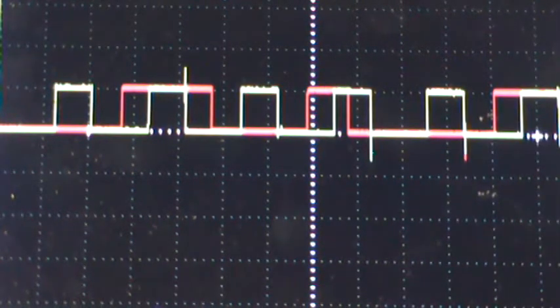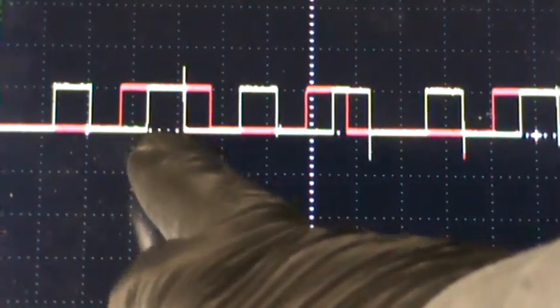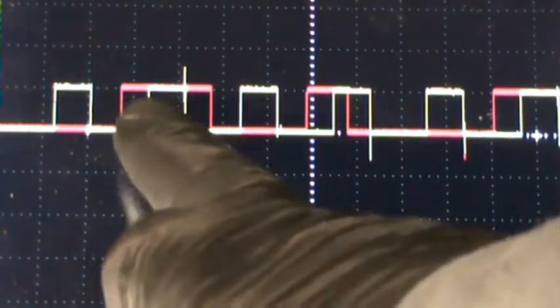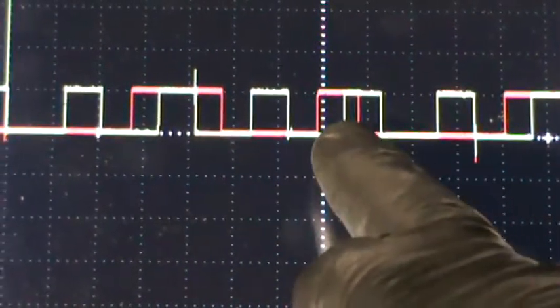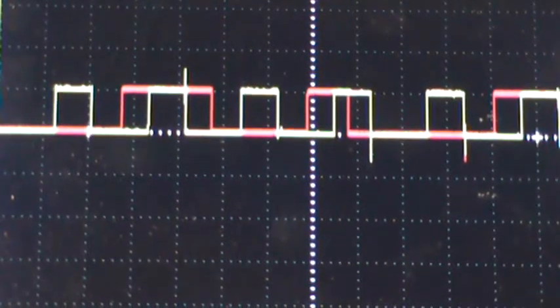From the first line to the first line is 360. From first line to first line is 360. If you think the vehicle is out of time, you just look at this and you can tell it's in time. You can see the defining characteristics: this yellow square wave is directly in the middle of the larger red trace, and this wave is directly in the middle of the shorter one. So that's the defining characteristics of this square wave — it's not really that difficult.